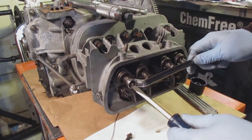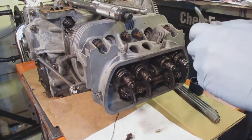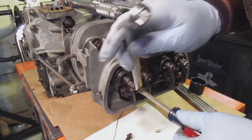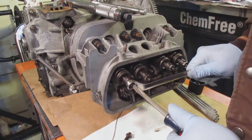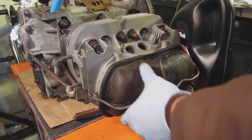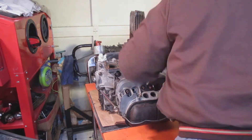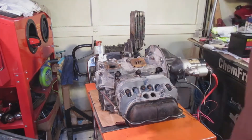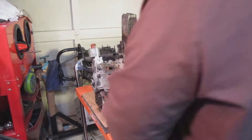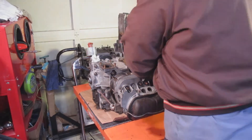Once the initial start is done, I know exactly where top dead center is located and I'm able to go through and properly adjust everything — timing and everything — and adjust the valves. Often times I don't put the valve covers on, and I won't keep them on when I do the compression test.